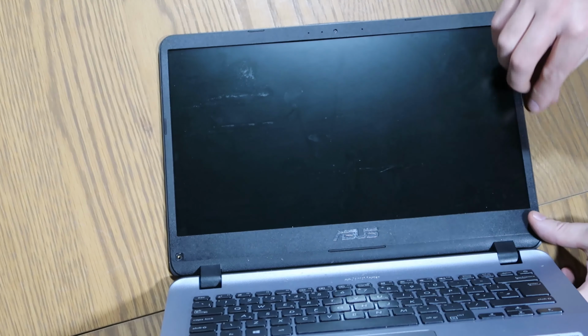And you want to just go around the screen a couple of times. Just make sure everything's clicked in, there's no more clicks or pops. Then we're going to do our 2 corner screws, so I'll just pop those back in there and I'll tighten those up. There's number 1. And number 2. That's perfect. And then our little rubbery bits need to go back in there as well. So assuming you've done all of that correctly, then you should have a newly fitted ASUS screen that works perfectly.